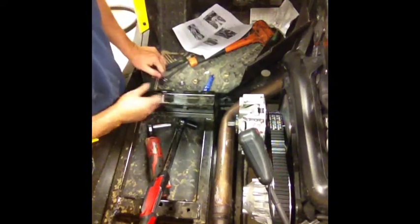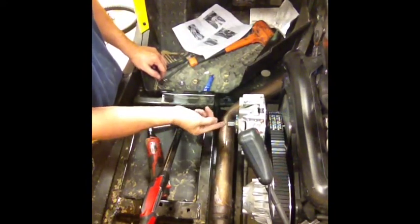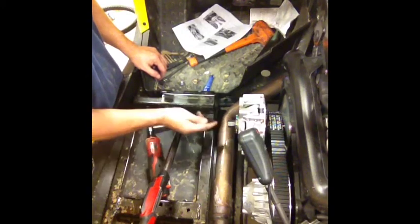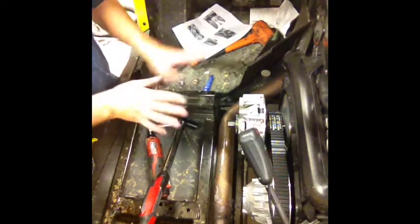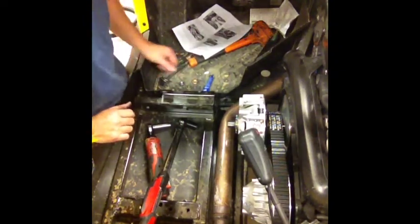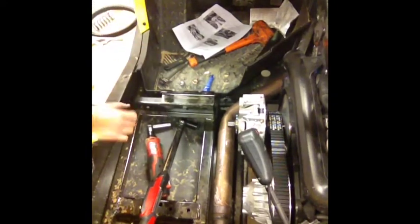Like I said, run it through a couple cycles, come back, torque it to 95 foot-pounds again. You can loosen your nut up, torque it to 95, put your set screw back in, back to 48. And you should hold — Can-Am knows what they're doing. This is going to be a solution to the potential issue. Thank you.